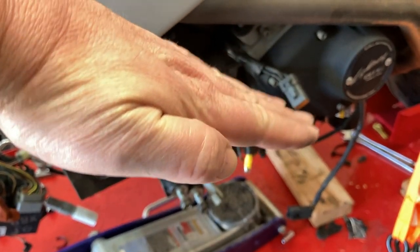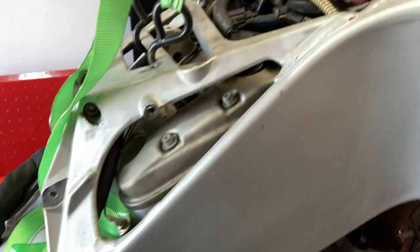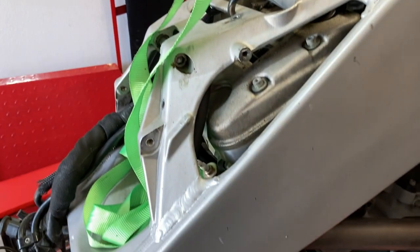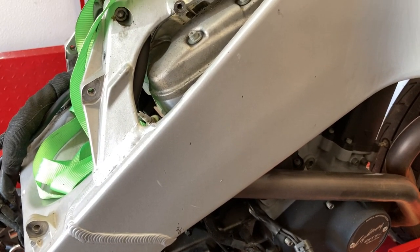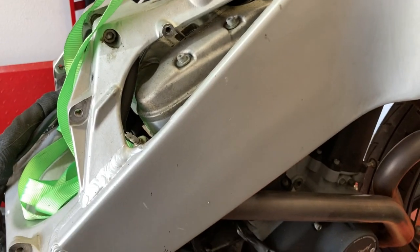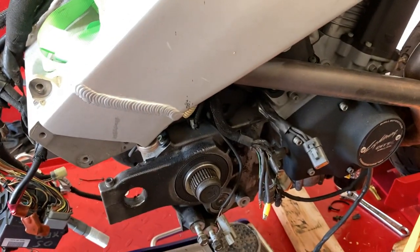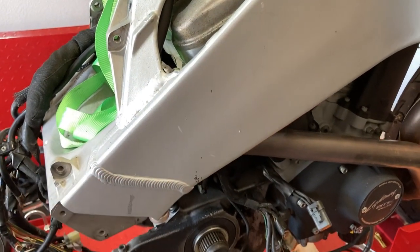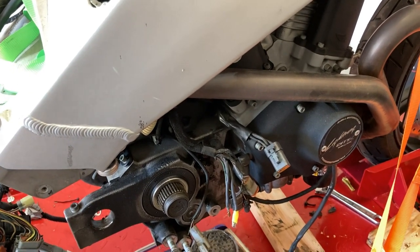My hope is that I've got enough front end stability to then lower the rear end of the bike. That will definitely unload the rest of the frame, so I have to kind of watch it. I should be able to unload some of the weight off those straps with the jack — lifting up the engine just a little bit more than I need to, just a smidge, should unload it enough to unscrew that and then come down real gentle.